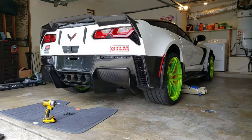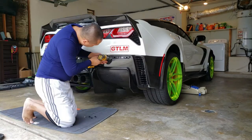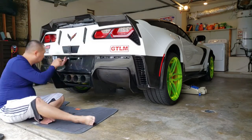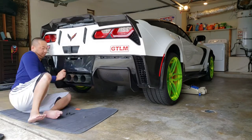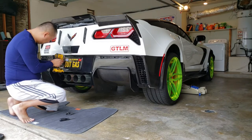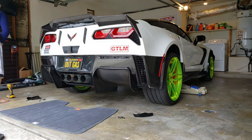To put it back, just reverse the process. I like to mount the top one first before I mount the bottom so I can hold the bumper back in place, then do the exhaust ones. That's just the sequence I like to do. I've taken this thing on and off at least eight times and nothing broke — it's fairly easy and simple to do.